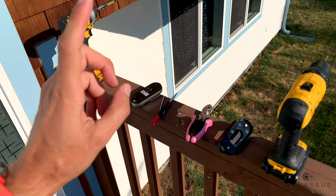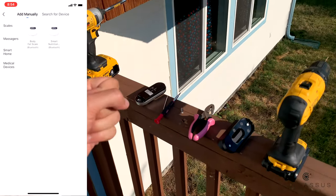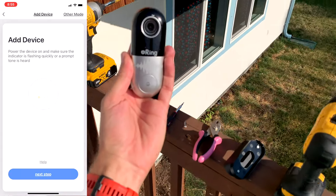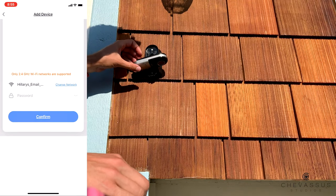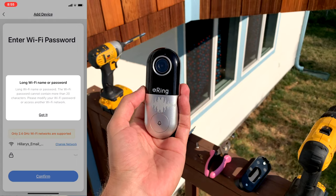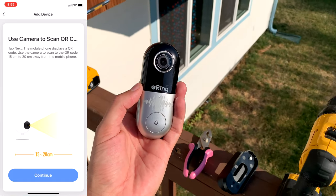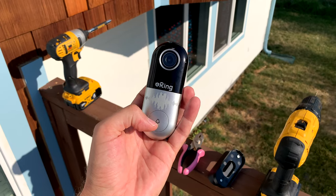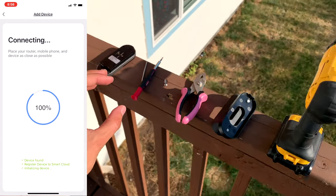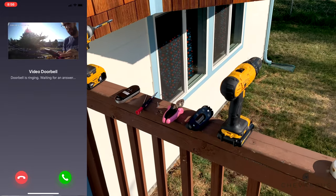Open up the app — this is not the most intuitive setup process. I was having difficulty connecting and it showed me a QR code. What I did was hold the QR code up to the doorbell camera, then pressed and held the button on it, and it scanned the QR code using the camera and automatically said you're set up. If you reach that step and it gives you a QR code, hold your phone up to the doorbell, press or hold the button a few times, and a message will come up saying you're connected.